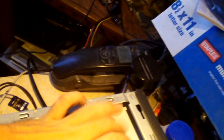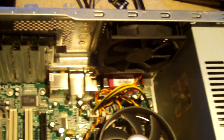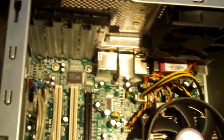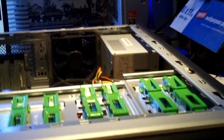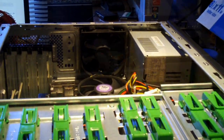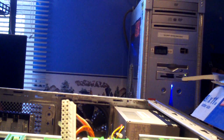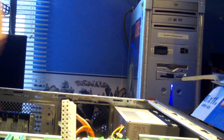What I'm going to do is swap power supplies and see if it shows the same behavior - there might be something wrong with that power supply by chance. Again, it was showing the same symptoms earlier with the original power supply; the symptoms were it was not powering on at all. Let me grab the original power supply and swap it back in. I've unplugged the power connections from the motherboard. The power supply itself is not powering back on its own without being paper-clipped, so to speak.